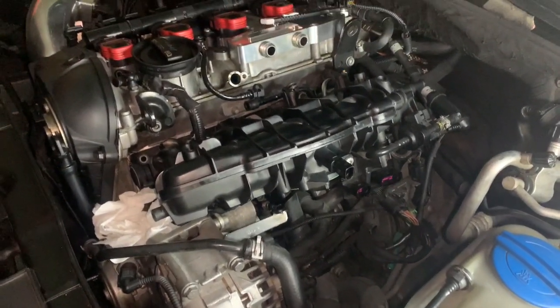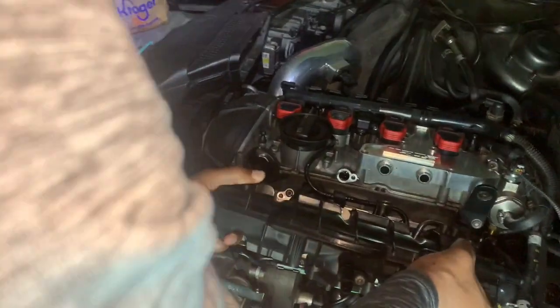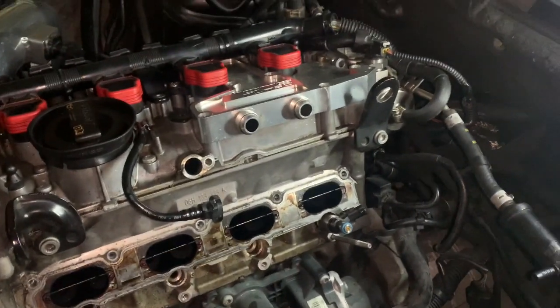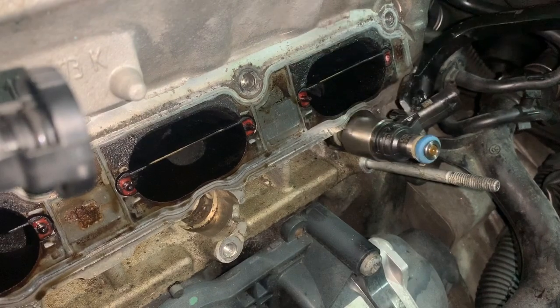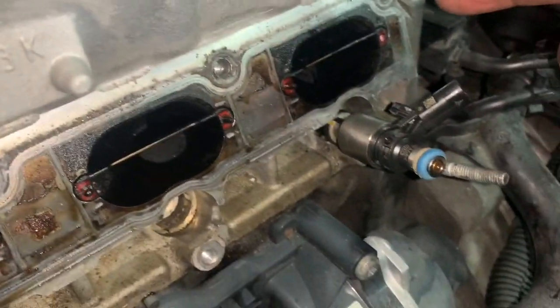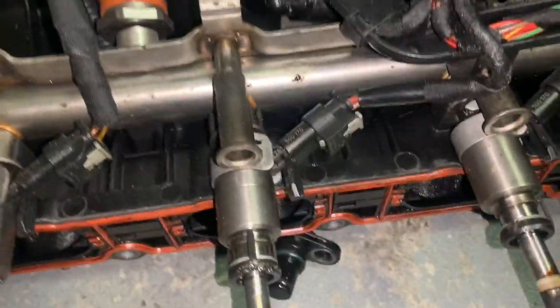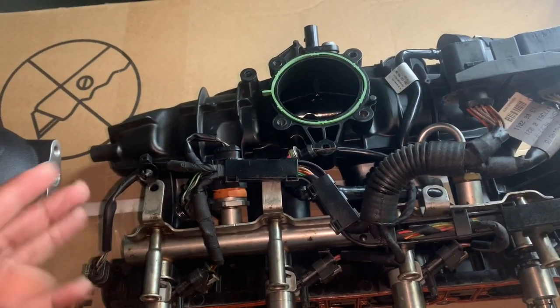It's time to take out the intake manifold. It's going to feel really tight like it's stuck, but wiggle it from side to side just like this. The intake manifold is now out. As you can see, one fuel injector got stuck inside — to get it out, I gently went behind it and pulled it out this way. Be gentle because this is plastic and very brittle and it can break. The intake manifold is supposed to come out with the fuel injectors in it, but sometimes if it seizes up you'll have to remove that extra fuel injector separately. The factory intake manifold is successfully removed.